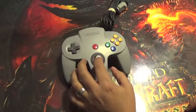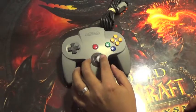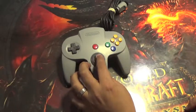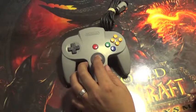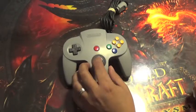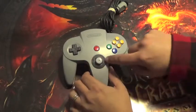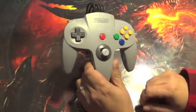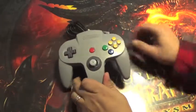The most common thing you'll find on a lot of N64 controllers is a real wobble in the analog stick. This one doesn't have a wobble — it actually seems fairly tight, almost borderline too tight. It's a little gummy moving in a few directions, but it does spring back properly. I'm wondering if something's gotten inside the controller itself to prevent it from moving around smoothly. There does appear to be a lot of gunk in the hole in here.